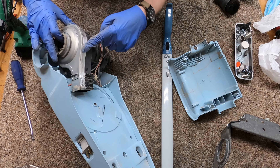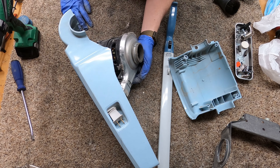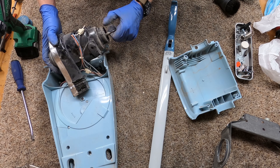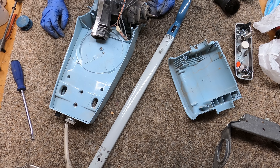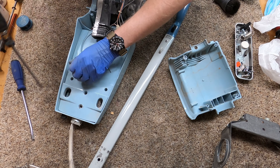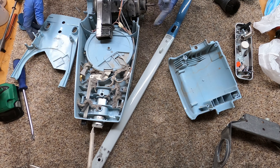We're going to get the bag off, and the bag is going to just get washed — basically that's the only thing we can do at this point. The bag was having some trouble coming off because it's stuck in the tabs. There are these big tabs for this — and there you go. You can see all the dirt that was basically holding those tabs in place. I've taken the machine further apart. Metal tape was part of the construction — Hoover did this for a long time. You can see it's leaking; that tape is no good.